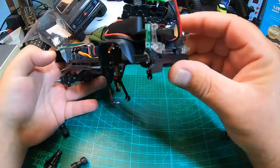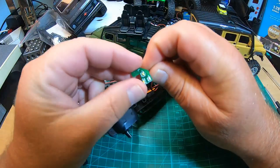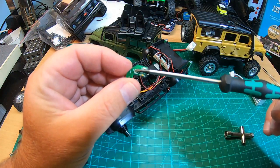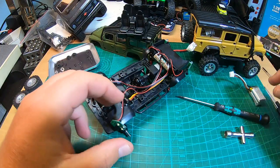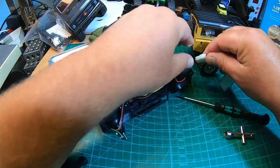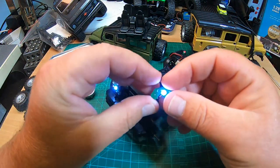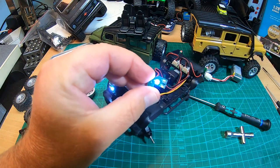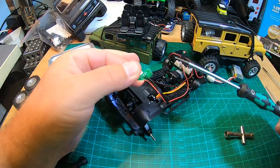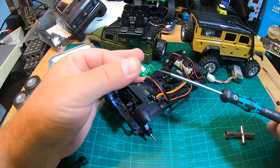Interestingly, there are proper light boards front and rear. You can see three LEDs per side — one should be a fog light, one the main beam, and one the turning light. But unfortunately the fog light doesn't seem to work. The turning light works, but the fog light does not. I can't see any obvious fault from here.